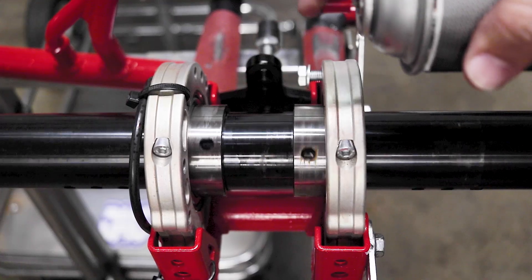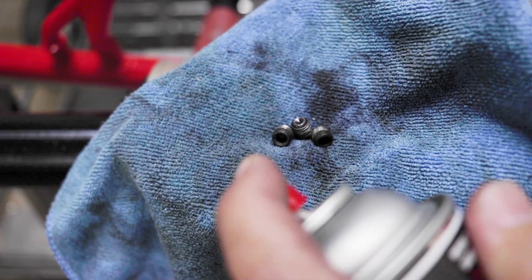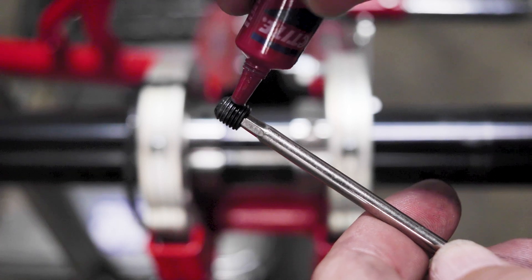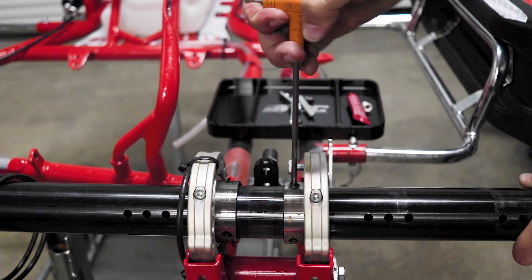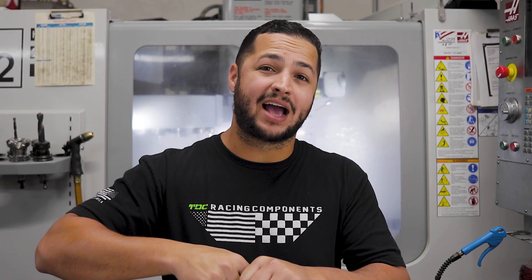Use your parts wash to clean the threads of your bearings before you put the set screws in, and also clean the set screws so there's no grease or WD-40 on there. That way when the metal tightens against itself it doesn't back out easily. After everything's clean, put a drop of Loctite on the set screws. Use blue Loctite — not red or green, because that is way too strong. When you tighten down the set screws, I like to do it three times: tighten, loosen, tighten, loosen, then tighten up again. That way the set screw digs into the axle and really gets a good grip so it doesn't slide around while driving.